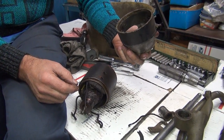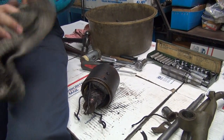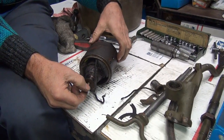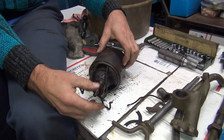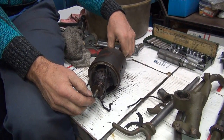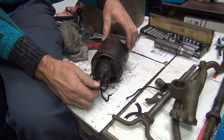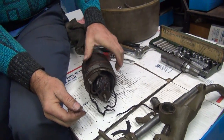This is supposed to be natural aluminum, not painted. This is a good piece — it's not corroded, nobody's been beating on it with a big hammer. Or you can put a two-brush generator in there and make it like a new bike. Cycle Electric makes a real nice generator — if you want to replace this with a two-brush Cycle Electric generator, we can do that. What does something like that go for? Just under $500. Well, you're going to have $500 in it rebuilding this one anyway. It has a regulator on the end of it, so it eliminates all your cutout and stuff. They're very reliable, they work very well.